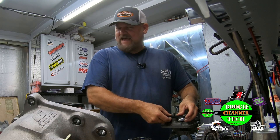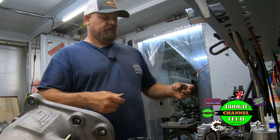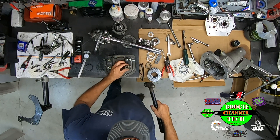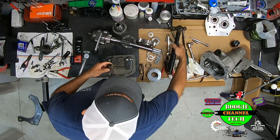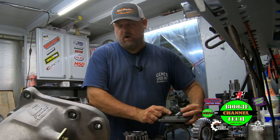I'm going to show you the difference. It's tight — it won't even hardly go on. This is the way they're supposed to be. I take an old bronze distributor gear I've got, put it on there, tap, tap, tap. You just heard it talk where it went 'clump.' Now there is no play.